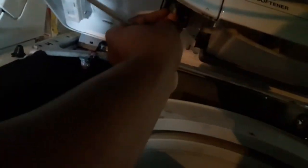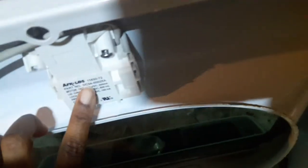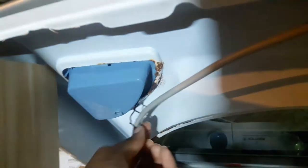Use some plywood to prop that panel open just like the hood of a car. Locate the sensor in the back that you pushed through the hole, pull it through, and follow the wire all the way to the front. That white box right there is the lock sensor. Unscrew and untwist the wires on the side of the door, then take out the screw of the lock sensor and disconnect it.